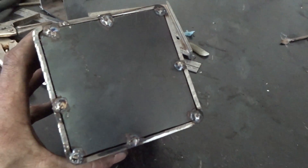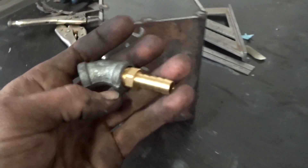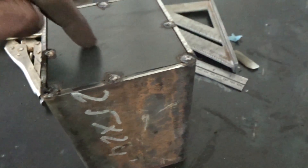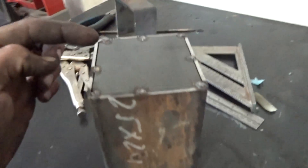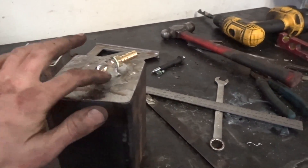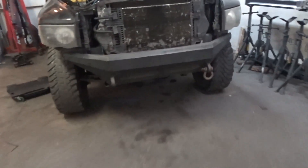I just tacked this piece of steel in there and I'm going to weld it all out, then grind it flat so it looks like one piece. For the drain, I didn't have a 90 fitting sitting around, so I'm just going to cut this on a really sharp angle and cut a hole here — put that on like that, so it's as high as I possibly can, basically really flush with the bottom. The further I go down, the higher I have to mount this thing in the engine bay. The weld didn't look very nice so I just ground it all off. I put some water in there and it didn't seem to leak at all. Now I'm going to build a bracket.